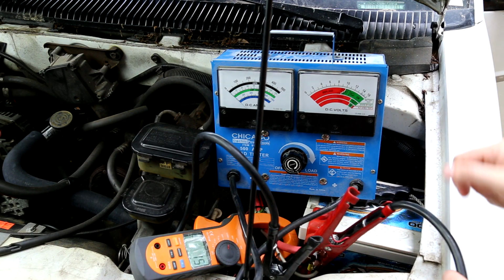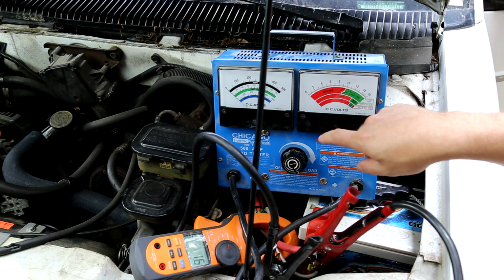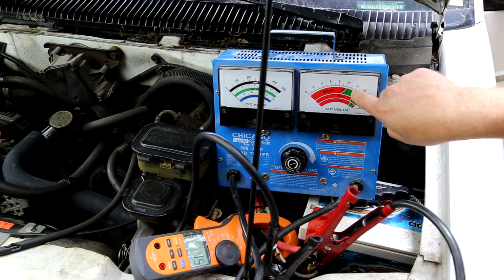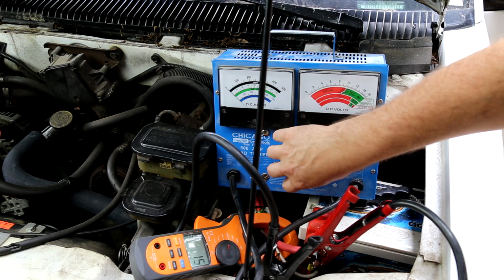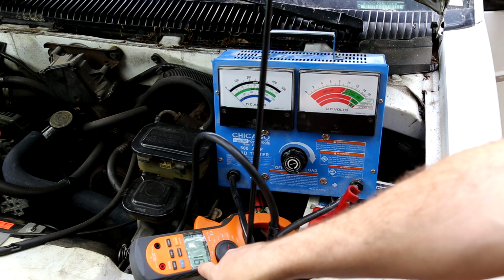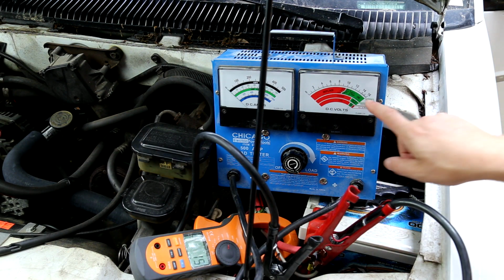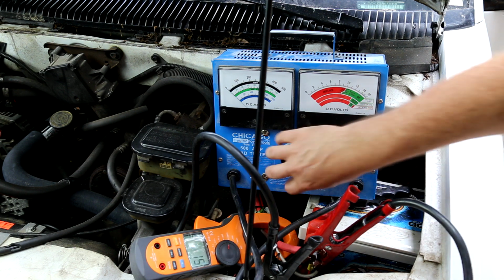showing 16 amps, and I'm going to ramp this up until this gets down to maybe 11, 12 volts, and that's where we're definitely going to be in battery power. And whatever number that says, which again may or may not be accurate, we'll have to check from here, which will be accurate. We'll see exactly how much current that is. Once we're down into 12.5 volts, we're completely in battery storage.